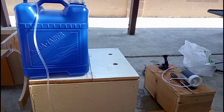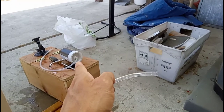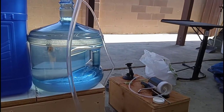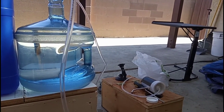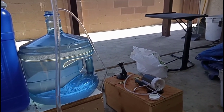This is how my water system was set up inside the minivan. It's not in the vehicle right now but I'm going to simulate it. I was parking and the hose coming out of this end came loose from the pump. I'll simulate it with a water bottle — I already primed the water into the hose. You can see the water level stays equivalent to the bottom, but once you lower it to the ground, gravity feeds it and the water starts coming up. That's the problem — it came loose from the pump. Once you move it up high it won't leak. I'm going to show you my new setup to prevent that from ever happening again.